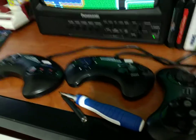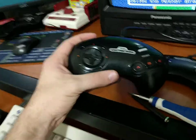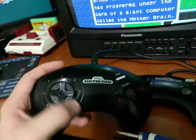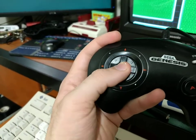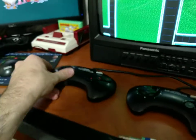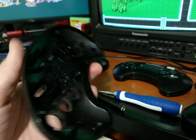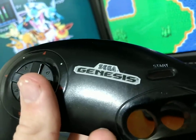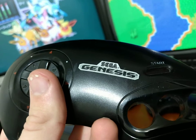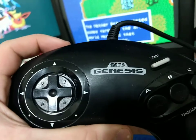There are a few different variants of the three-button controller. There's the earliest kind, which has the red print - makes it pretty obvious. They have an old, kind of, in my opinion, cruddy D-pad, but you can remove it easily. So I have one that I've already taken apart here. Easy to tell, as I said, the red print. And you'll notice that the Genesis logo right here is in two tones of gray. The later ones, all that I've seen at least, are just one tone of gray.